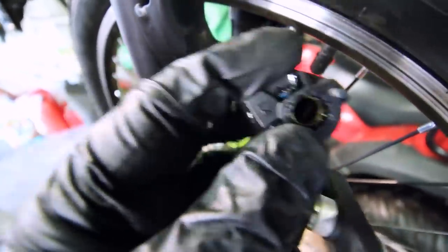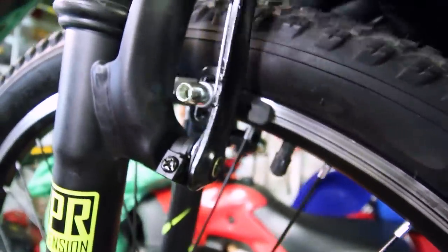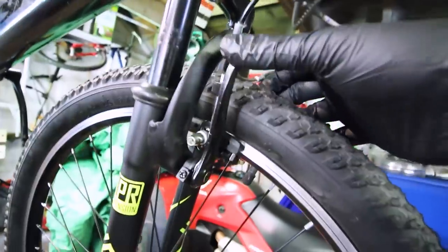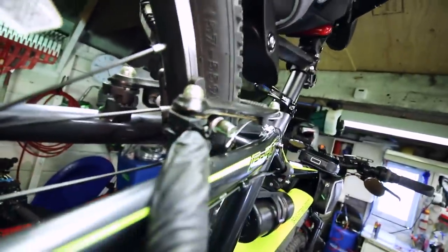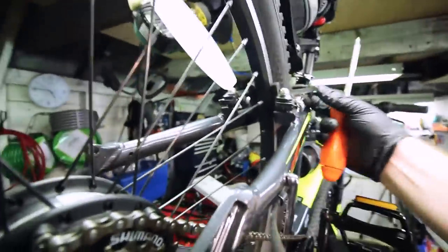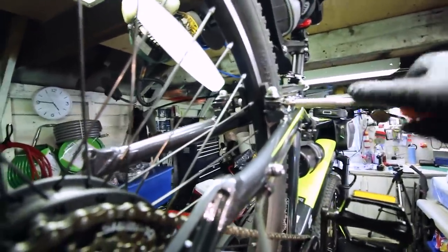After a few rides, there were definitely a few things I had to deal with — the most important being the brakes. I disassembled this so you can see this Phillips head through bolt, which is what adjusts the spring pressure on your brakes. On all four, these were completely backed out with almost no spring pressure on the brake itself, which means the brakes weren't returning to center and would drag. This is a very easy fix: you just thread these in with your screwdriver until you get ample spring pressure. You can even balance them from one side to the other, since the cable will hold a little bit of tension differently from one side to the other. Tighten the side that needs to be pulled out further and the brake will release further on that side and center more — and then your brakes will stop dragging. You can pretty much just wind all four Phillips screws in until there's quite a bit of tension on them and you'll be just fine.